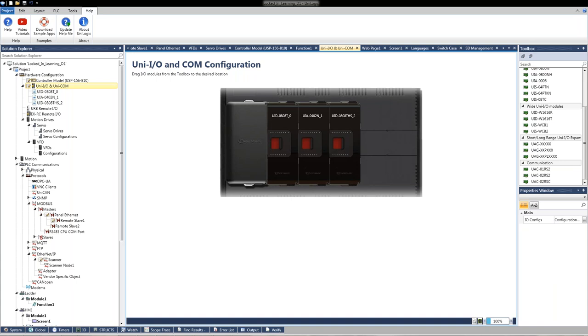Can we connect a printer to get data every minute? It all depends what you're trying to do. If the printer works with print jobs, we are not able to create a print job for the printer. But if the printer supports FTP, which a lot of new modern printers do, we are able to FTP files to the printer for them to be printed. So it really comes down to what the printer is and what data you're trying to get.